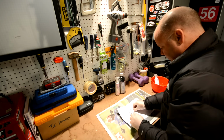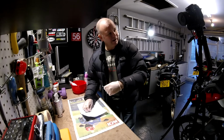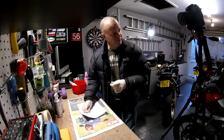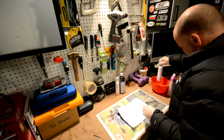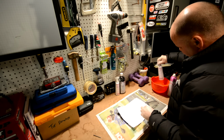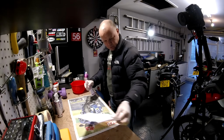And what I'm going to do is treat one with ACF50 and not the other one, then I'm going to stick them outside for a week, and then we'll come back in a week's time. I'll put that at the end of the video and we'll see what's happened to them. Okay, so I've got some ACF50 here, which has just been warming up in this hot water for the last 10 minutes or so. Give it a little shake, and apply it on this one.